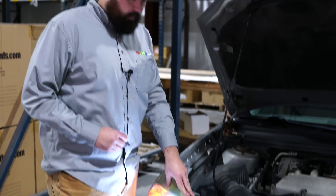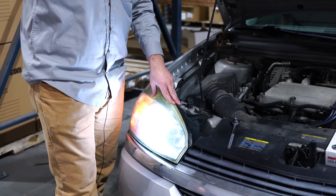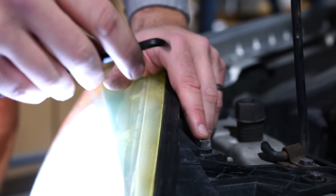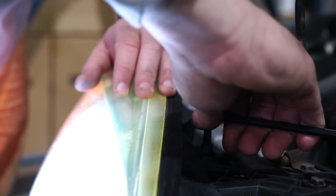This one ended up a little higher than our cutoff point that we measured earlier, so we're going to adjust it and bring it down below the cutoff point. For this vehicle, it's an Allen wrench right here, and we're going to go counterclockwise to lower the beam.